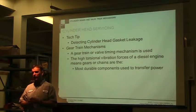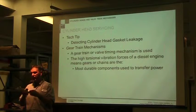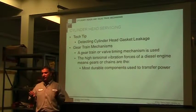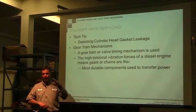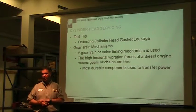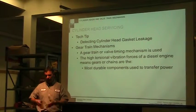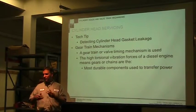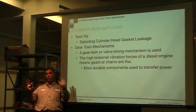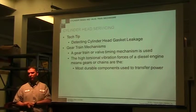You can also do an analysis. You can take a coolant analysis, send it into a lab, and they'll show, hey, there are carbon deposits and that kind of stuff in it. But most of the time, I got milky oil, or I got bubbles coming out of my radiator. The Toro fairway mower, the student drove by me and I could smell antifreeze. I lifted the hood and the overflow tank was kind of foamy and running out the overflow reservoir. It's like, whoa, shut this thing down. We knew we had a problem right there. So it just was pretty simple.